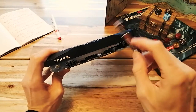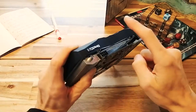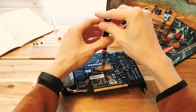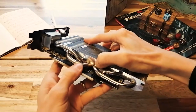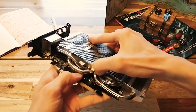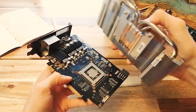They're not expensive. All you'll need to do is take the GPU apart by removing the screws that attach the big metal heatsink to the graphics card. Disconnect any wires that are plugged into the board, and when you're ready, slowly and carefully lift the heatsink away from the graphics card. If it's being stubborn, you can twist the heatsink a little bit while you lift it.